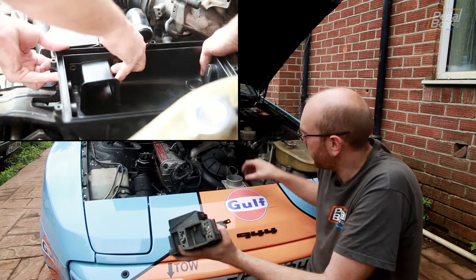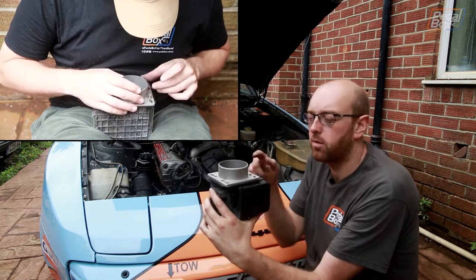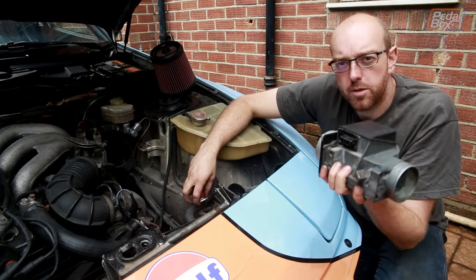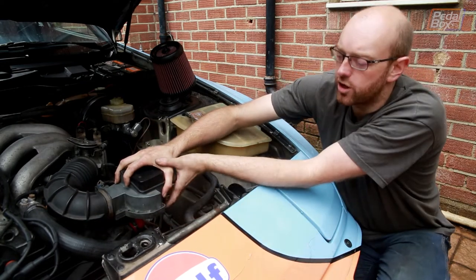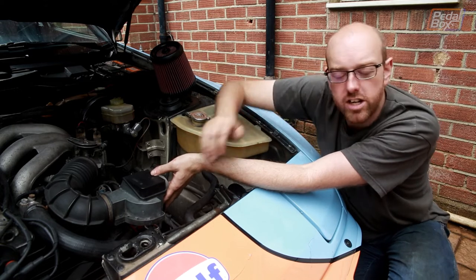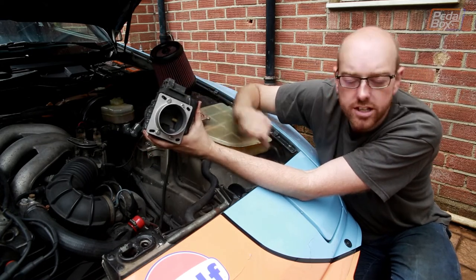In order to put the K&N filter on, we have this little adapter — just a piece of machined aluminium with a flange that goes onto the front. The problem is all the mounting brackets are attached to the air box, so we're going to have to make something to go from these bolts just in front here to hold up the bottom of the MAF. We're going to drill a couple of holes, fit it, then measure up for the bracket. Just before we put the MAF on, I'm going to cap off the original crankcase breather tube because we don't need that anymore. The MAF just goes in like this with the new bracket on.